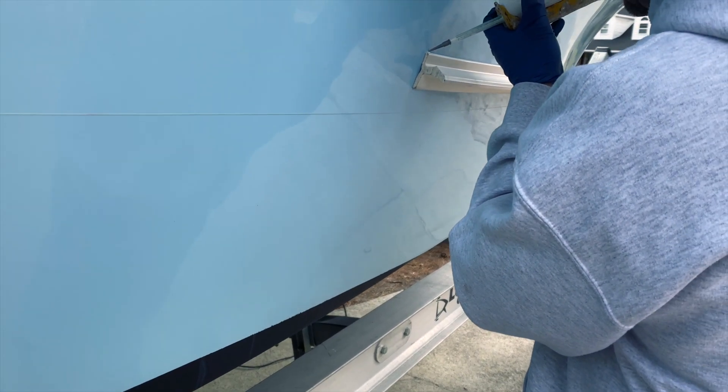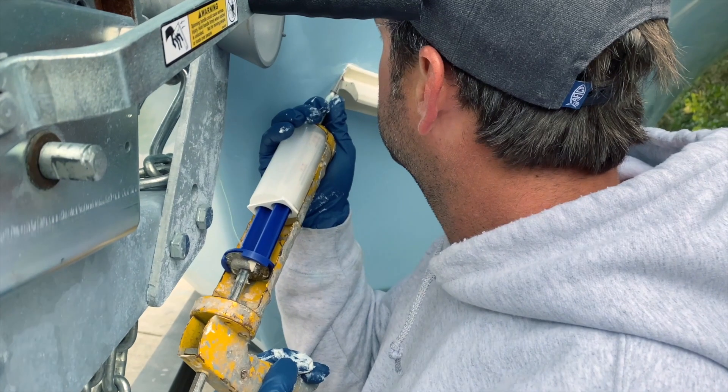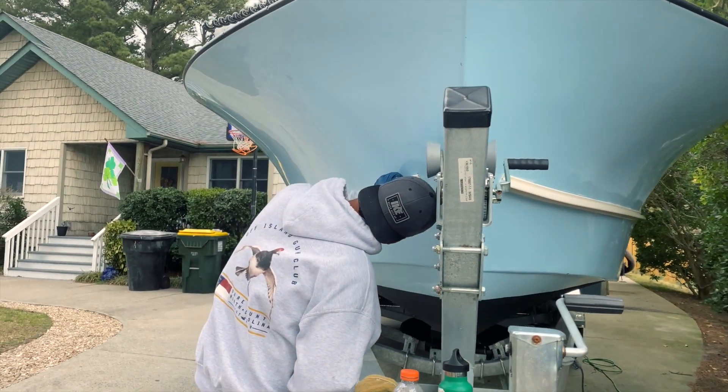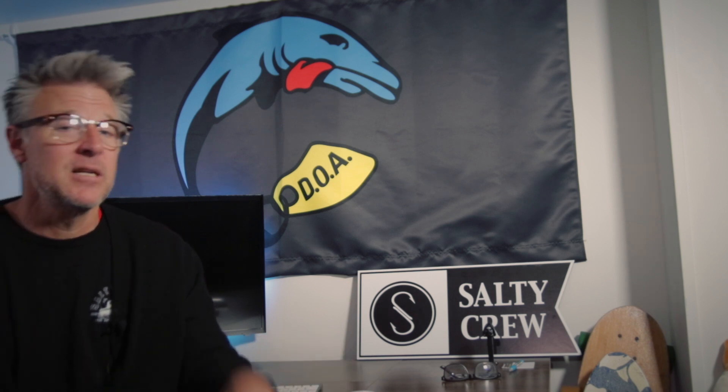I need to emphasize this: the glue that is used with these rails is very strong — strong enough that there isn't a second chance if you put your rails on crooked. Two-person job. While Dave was squeezing the glue into the gaps at the top and the bottom of the rails, I was gently pulling up or pulling down so he could get the tip of the syringe into the crack. It's not very hard, but don't be stingy with the glue. Just don't get it on your fingers — pretty sure your skin will come off as well. Walk around and look — your rails are affixed. Admire your work, high five your helper. You and your passengers are going to be dry and happy.